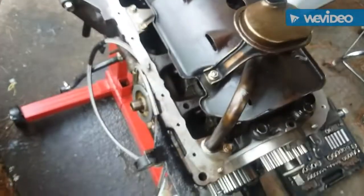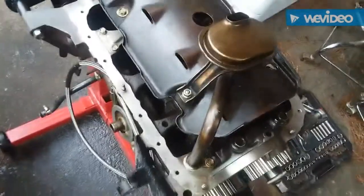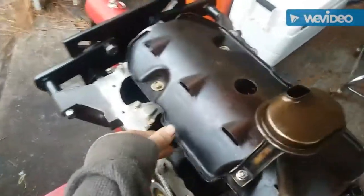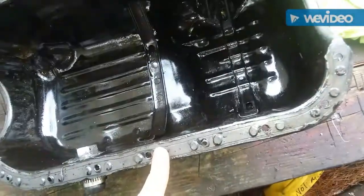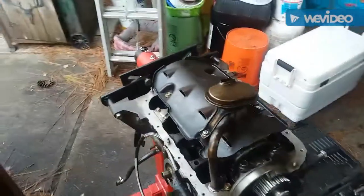All right, we're back here with part two. Recap: new bearings, rod bearings — this is a couple days later, my back's been messed up, just tired from overdoing it. But we're back. Get this cover on, oil dipstick, add a little Honda Bond. I've never had any luck getting these gaskets to stick, so we're gonna try a little Honda Bond. I gotta get this whole area cleaned up, but we're getting there — hopefully I'll have this done today.